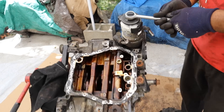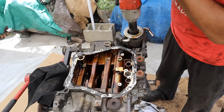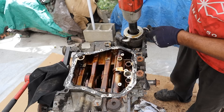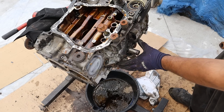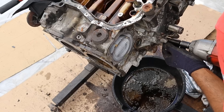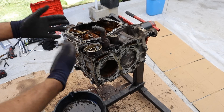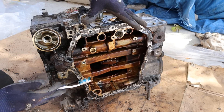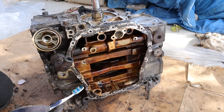Let's get the oil filter off here. I'm glad to see that they do have an oil cooler on this turbocharged model. I'll remove the oil cooler from the block. The last piece is the oil pump which is in front of the crankshaft. Now in order to tear this thing down further, we need to get it off the stand to split the block. Taking a look at how the block of this boxer engine is constructed, you've got two halves that split down the middle revolving around the crankshaft.